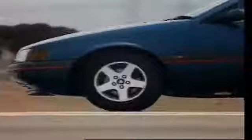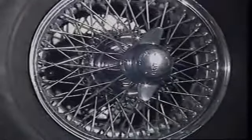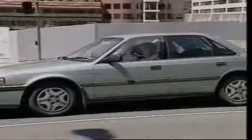Applying brakes can absorb a lot of vehicle energy, so friction between braking surfaces generates great heat. Brake parts withstand very high temperatures. Most of the friction area of a disc is exposed to air, so cooling is far more rapid than for a drum brake. Unlike drum brakes, brake fade is rare. Because of this shape, discs tend to throw off water, so after being driven through water, they operate almost immediately.